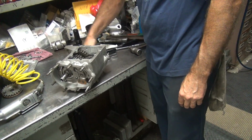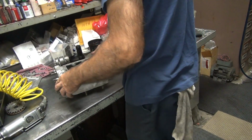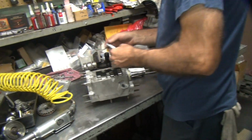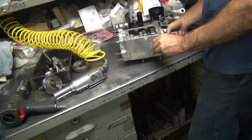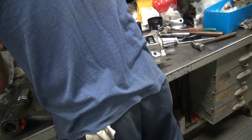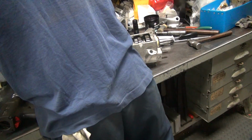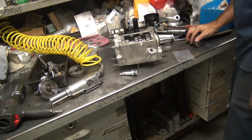Little gear works. Put the speedo thing in there. Dude, my speedo gear. You want everything to be functional? There, put a gasket on it. It's brand new. Ooh, it even rotates without binding. That's the key part. Don't forget to drop a little oil in it. You want a gasket, you want oil. Where's the gasket going? You can see there's a gasket.